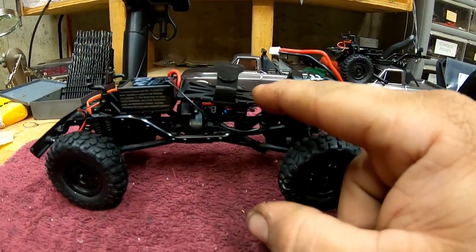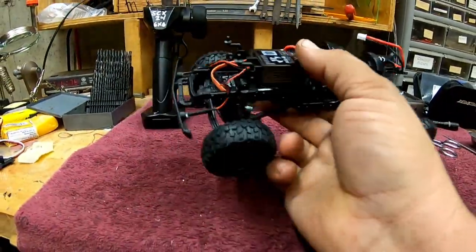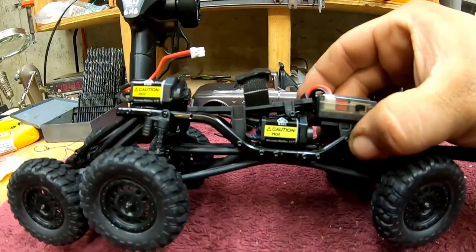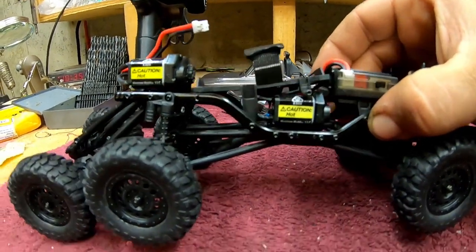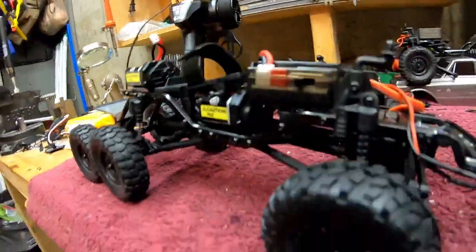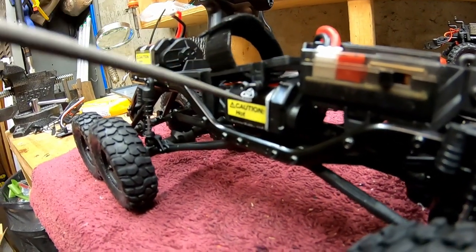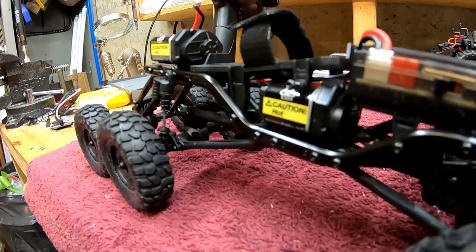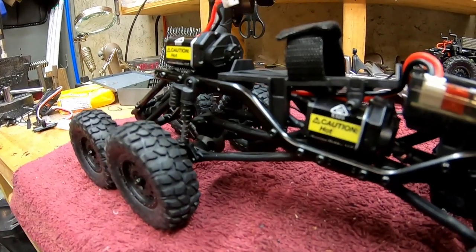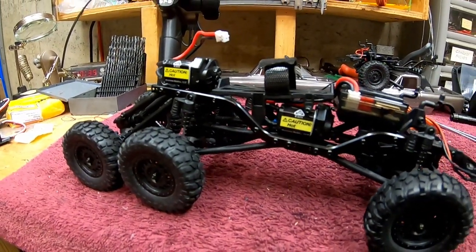I may have forgot to mention you got to turn the battery tray around, just unscrew it, turn it around, and it screws back in. The only little issue, which I still have to correct, is this tab hits the motor and makes the tray flex a little bit. You could go ahead and cut that tab clean off. I don't know if that's necessary. I'm going to try to get inside the back edge here and shave it down and just remove a little material and see if I can get it to clear without cutting that tab off. That way, if you ever wanted to use it again, you still have that mounting boss that you can screw into and have it be supported and as strong as it's supposed to be.